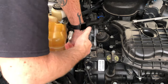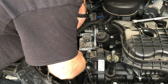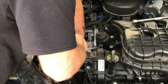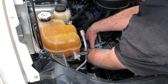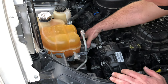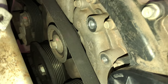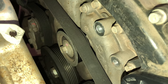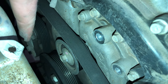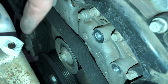Here's the bracket that holds the motor mount to the engine — there are four bolts holding it on. Loosen and remove the top two bolts, then loosen the two bottom bolts and remove the bracket. Right underneath that is the idler pulley, which is the part we're going to be removing. While lifting up the belt, loosen the bolt holding the idler pulley on and remove it.